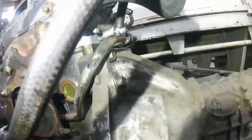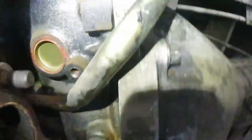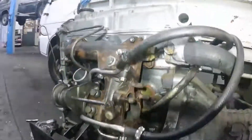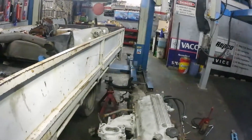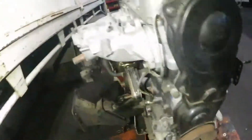The water lines — one goes to the cold water pipe and the hot pipe goes up behind the thermostat. All the coolant lines are done. Still need to make the exhaust downpipe, and we're waiting on the adapter plate for the Weber DGV carb because that's what's going on it — it's going to be a blow-through carbureted setup. Also need to change the harmonic balancer over to the V-drive setup off the truck.